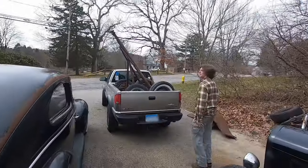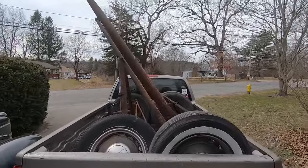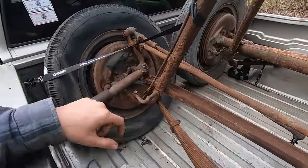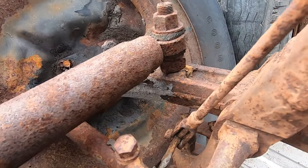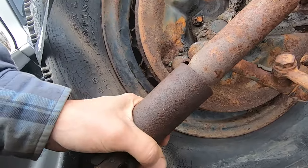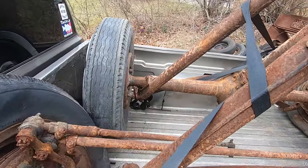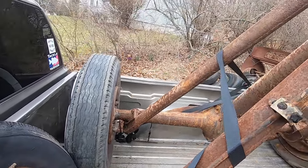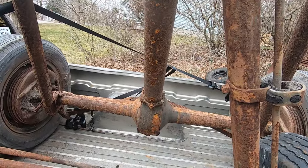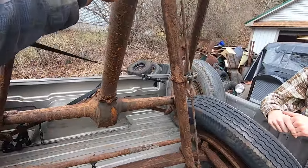I'm leaning a little bit more than when we left but it wasn't too long to drive. I picked up a flagpole on the way home. So we've got front and rear end from a '36 Ford. There's a shock mount from back in the day — you should have seen the shock mount on the frame. The shocks work pretty good. I don't have any rear bones for my '32, so here's some '36 rear bones I might use. I need the driveshaft from this guy, maybe — no, I can't use this one, they taper, and it's weird. '40s don't taper, right? People use these as exhaust headers — oh, the tube inside the actual driveshaft.